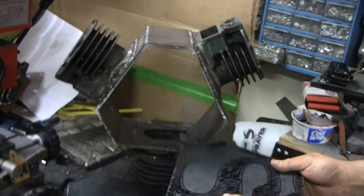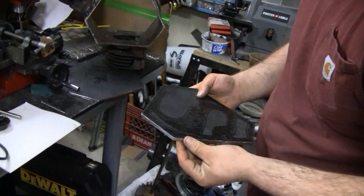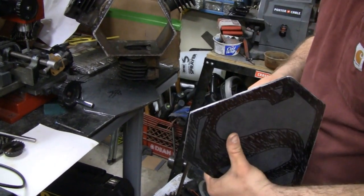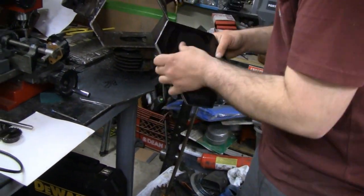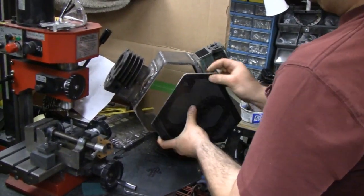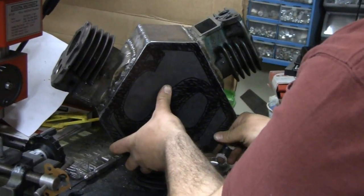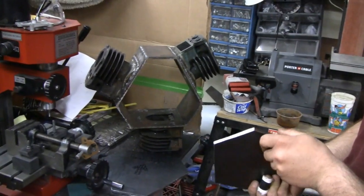It's coming together. We wound up cutting that with a cutoff wheel because we don't have a plasma cutter. And a cutting torch was going to be a little too sloppy and rough. We would have had to grind it out anyway, so you get a nice edge with the cutting wheel. Once we get it to the point where we can bolt it on, I'm going to work on locating the mounting studs. Once we bolt it on, we can shape it and clean everything up — clean up all the rough edges and it will look perfect. It will blend in.